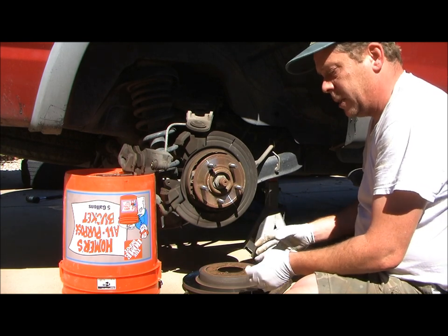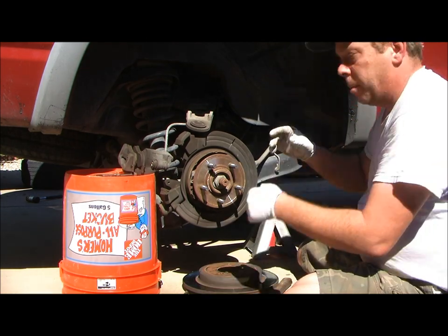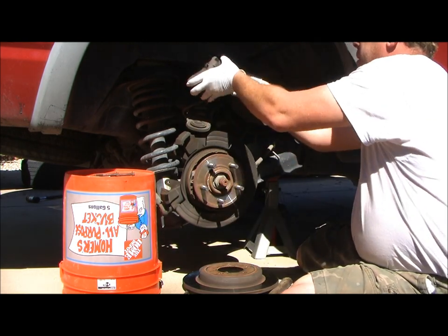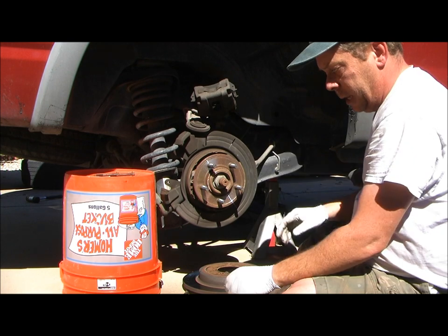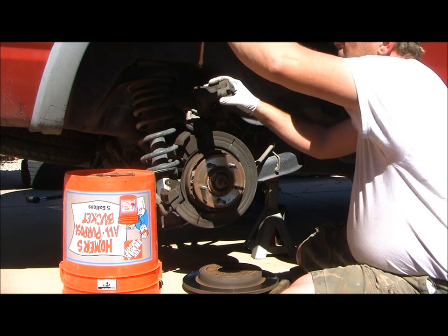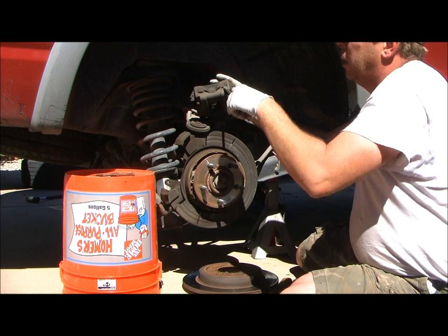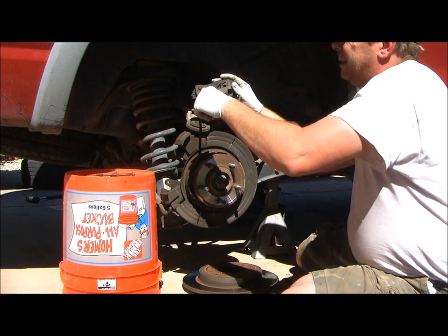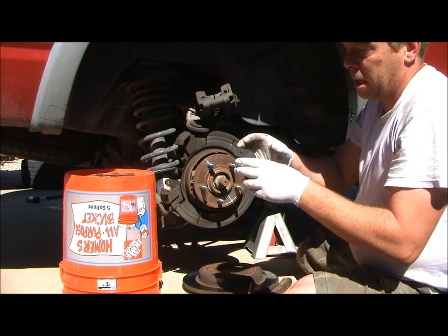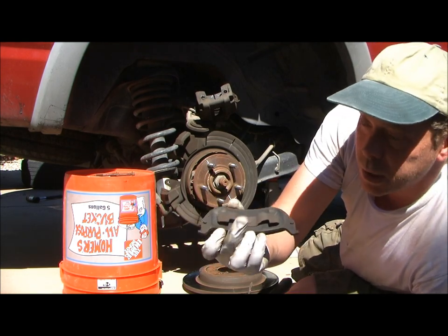If we were to go through and replace all of this, the first thing I'd do is get the rotor. I've got the parts so I can show you what the new ones look like. Next we're going to turn our attention to the caliper. Because of the way the rigid line is set up, we can actually sort of set it up on top to work on it. The pads are held in here by a spring clip. The outermost pad comes off first — get underneath there with a screwdriver and just pop it loose. You'll see that the mounting point has two circular holes right here — that's where the pins actually enter. On the shoe — the pad itself — there are two metal pins that come out of the back of the pad, and those go into those holes and it's held in place with the spring clip.